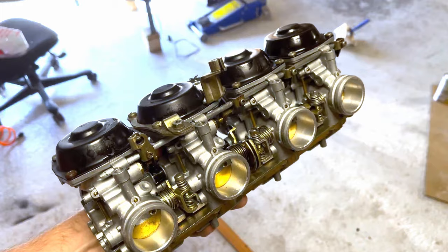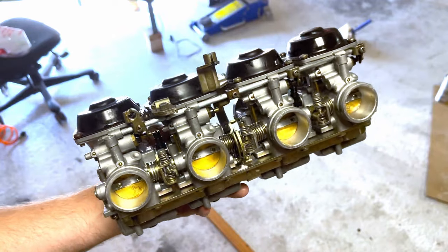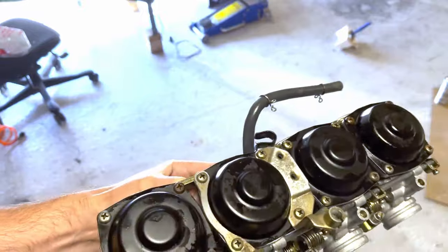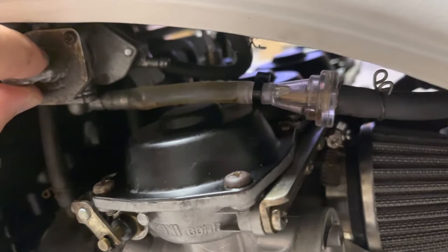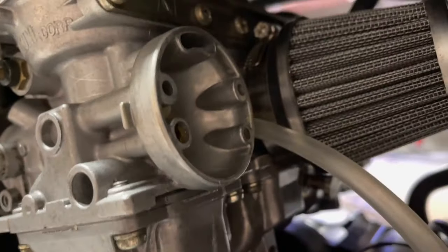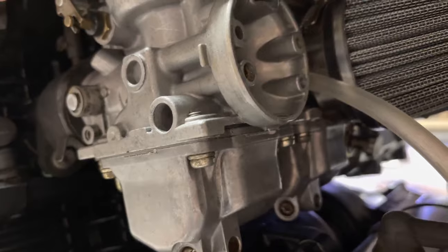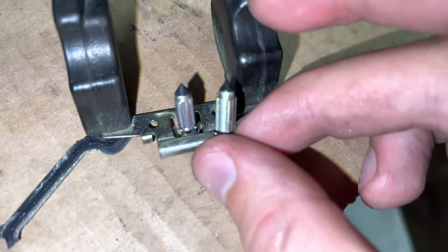Here's the finished product — they should be overhauled and cleaned. The choke holes in the bowls were all plugged up so I was able to get those cleaned. Now here's a shot of what actually happened: as soon as I opened the port on the tank it started dripping out, and it turned out three out of four of the fuel float valves were not sealing.